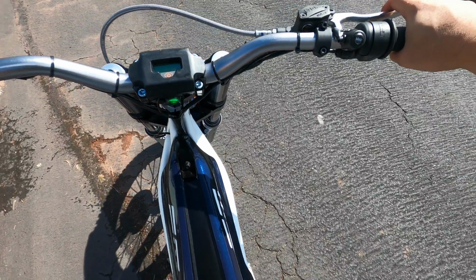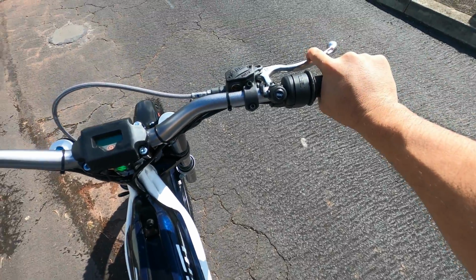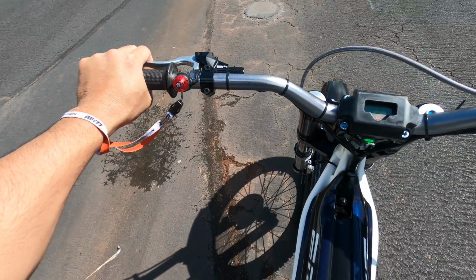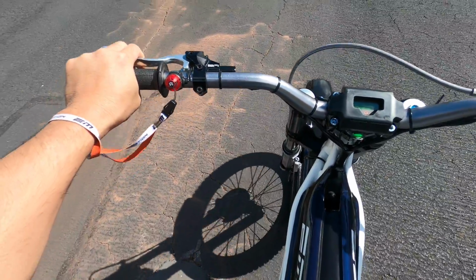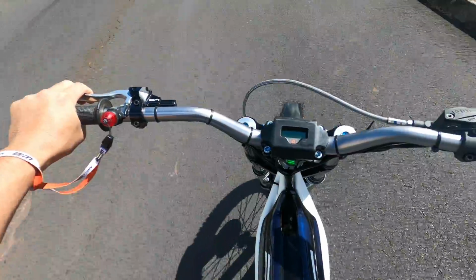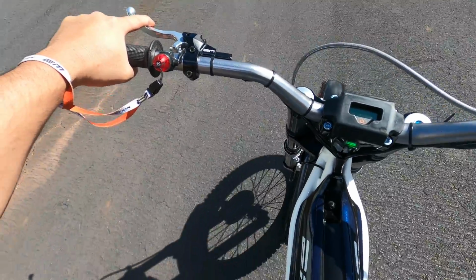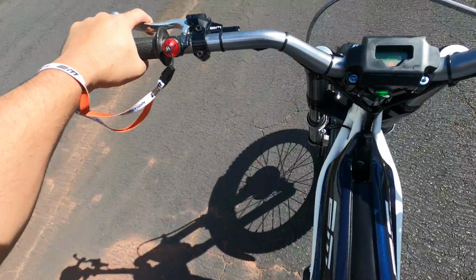You don't necessarily have to use your front, but what you can also do is give it a little throttle, and while your rear brake is disengaging itself, it will actually progress you as well, by just holding the throttle and progressing the clutch like a regular one. This is just 2-in-1: regenerative brake and throttle control.